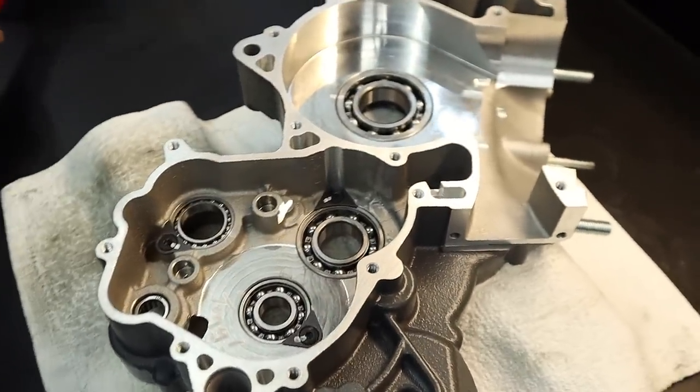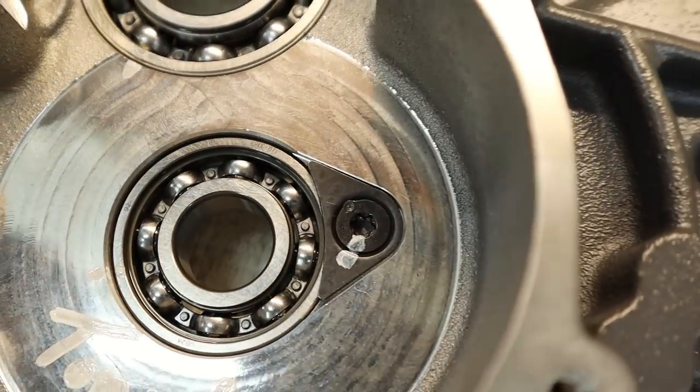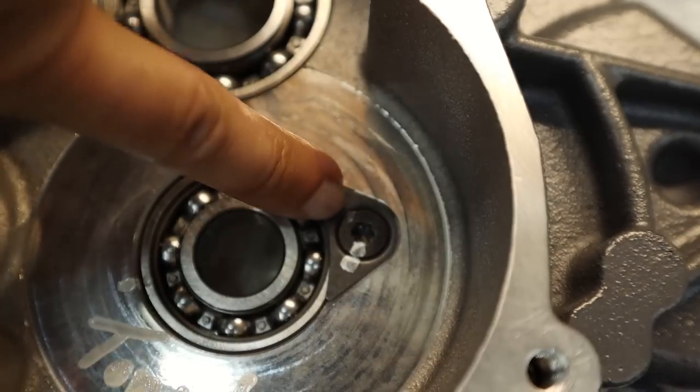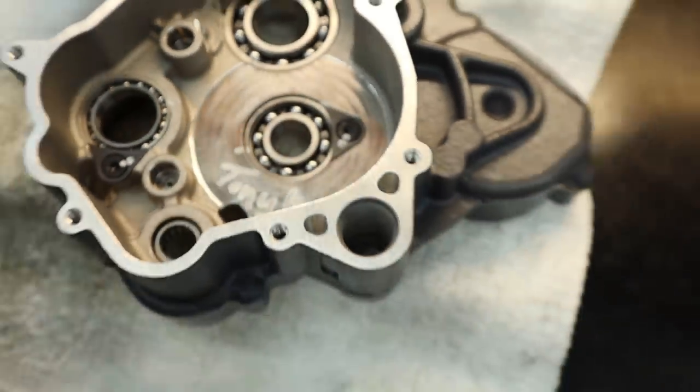That's a good hit. Whack it. Okay. You see how we folded that edge of the screw over into the retainer? So what will happen is now, if that thing wants to move, it's going to stop because now there's a roll into the retainer as well. It kind of locks them together. For sure. Sort of like a Woodruff key in a way.